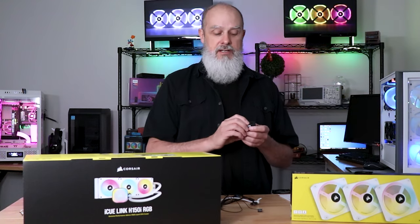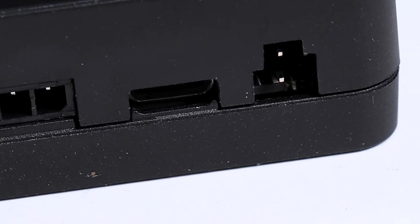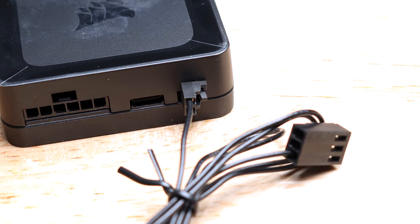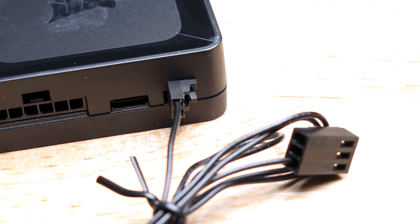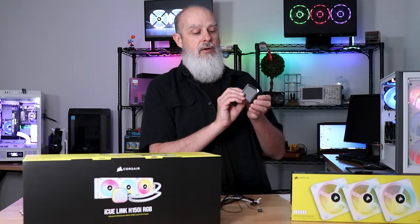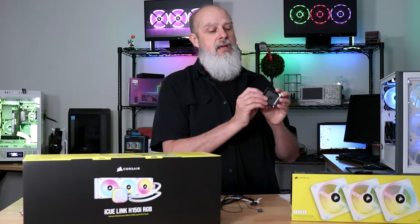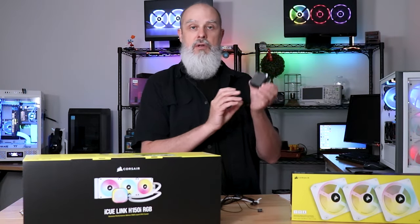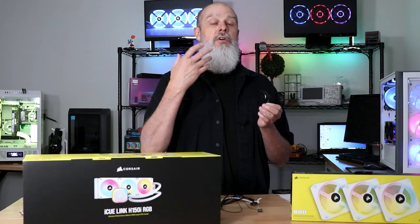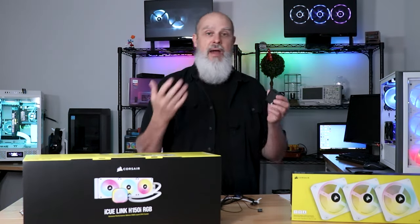There's also a micro USB connection that goes to a nine-pin motherboard header — that's how iCUE communicates with the device. The remaining port is a small two-pin tachometer port. For just the fan kit you don't really need it, but for the AIO you'll want to connect it to your CPU fan header so the motherboard is aware of the pump RPM. Corsair describes this as controlling up to 14 devices — seven per port — so you get two ports, each controlling seven.